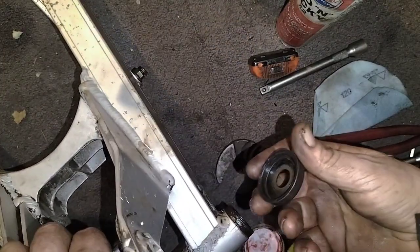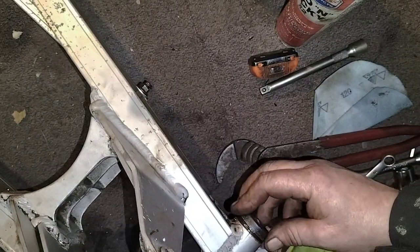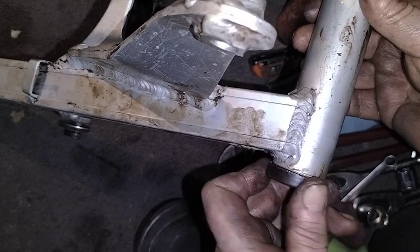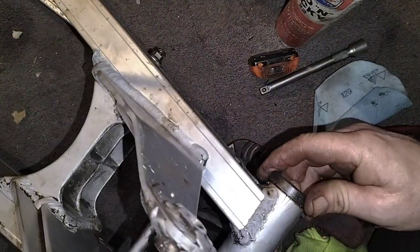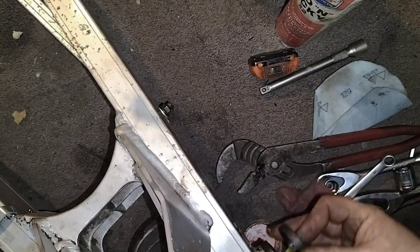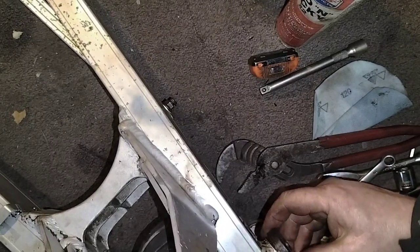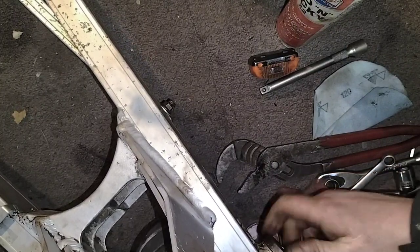Lastly for the swing arm, these caps are rubber on the inside, so they do seal it in. They go in there, and the same on the far side — cap goes on. Looks like we're in action. They have a nice bearing fit. This is what wasn't happening before — these weren't turning, they were seized in here. We're all good now. Nice bit of grease — I'll just smear a little bit on these to keep the moisture out. I'll put a little bit on the inside of these before I put them back on.